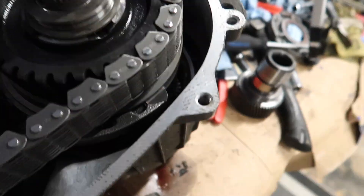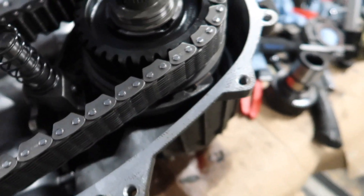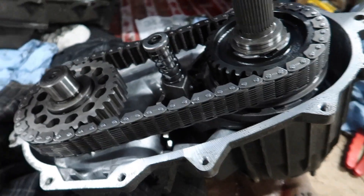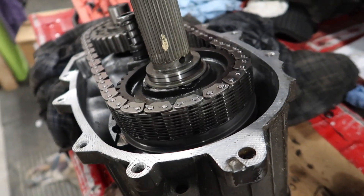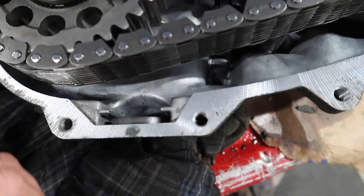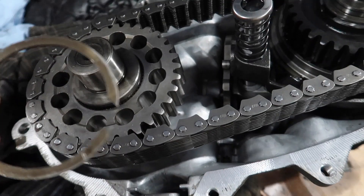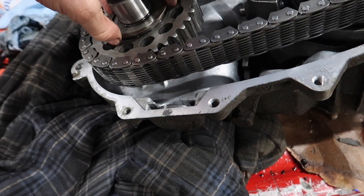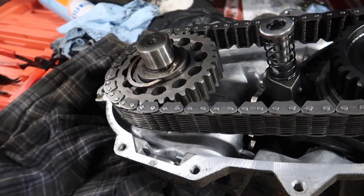Take your spring here, slide it back on — don't forget this washer, it goes on top of the spring. Grab your magnet too and throw that in, because the case will be staying this way now, so do that before you forget. Slide that in — it just sits right in there. Once you're done that, take your snap ring and put it on your front output shaft — it clips on there.